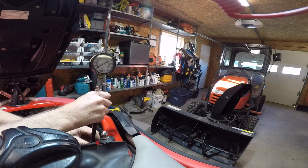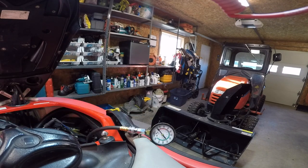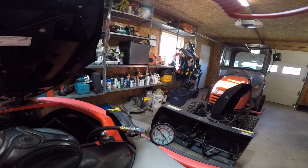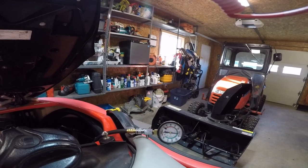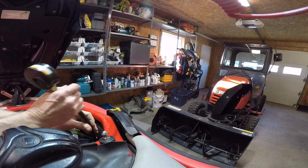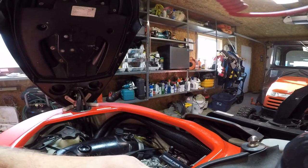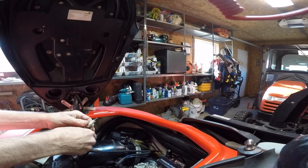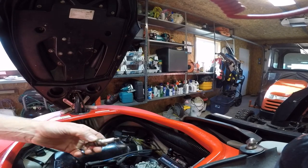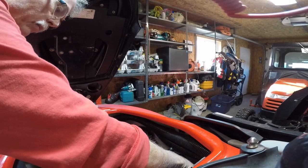This has all the engine storage spray in it and everything, so it's been properly winterized. Drown mode again. Oh yeah. Antifreeze dripping out the back. All right, you know what comes next. Let's put the plugs back in. Try firing it up. I gotta get some new plugs. These are the ZFR4F. I have 6F, I think, is for the RX, the other ones. So I don't know, unless I have the wrong plugs.